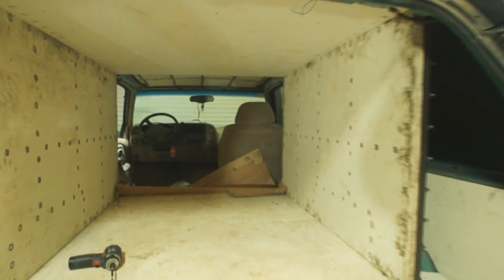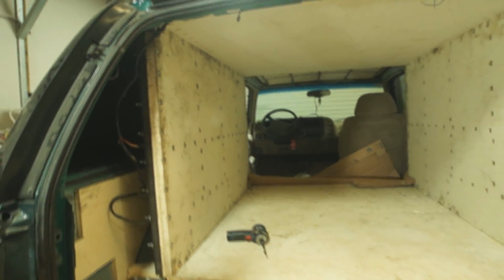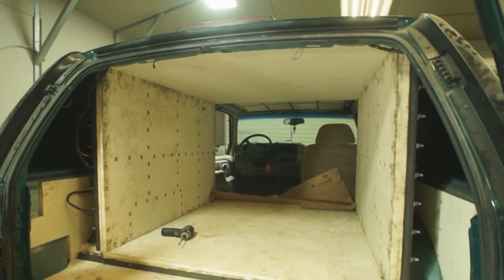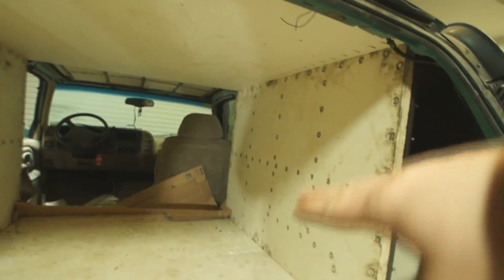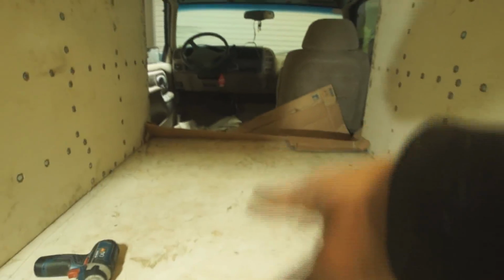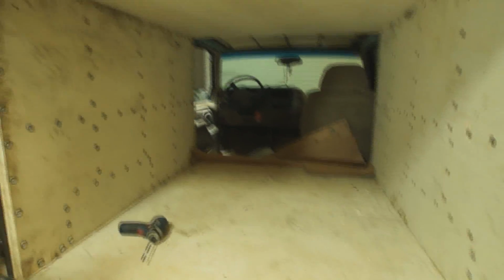So anybody that's following in, key thing for any sort of subwoofer enclosure is got to be stout. You don't want no sort of flexing. I've learned that over the past few years, especially with different builds and all, and how they flex and where they flex. That's the main thing. The bigger plane, of course, you're gonna deal with it in the middle, up top, wherever the bigger area is, even on the floor. In the center, up front in a ported section on a fourth order or whatever.